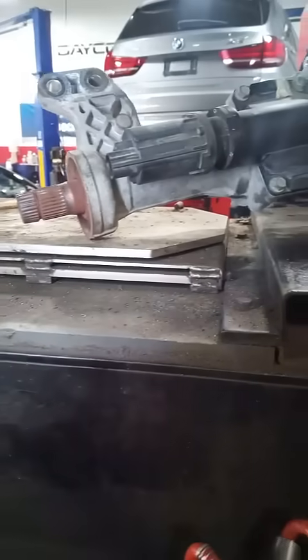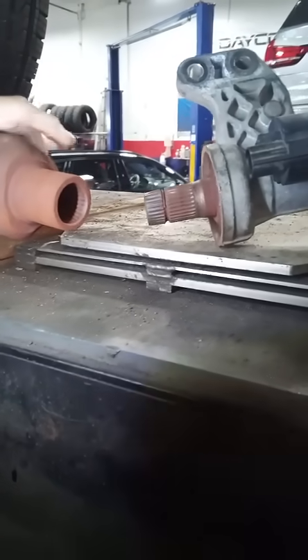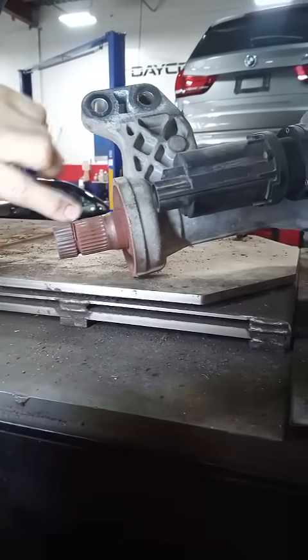Customer came in just for a regular inspection, no questions or concerns, but part of our inspection showed what we've got over here — out of this guy's front differential — this axle shaft was nearly coming right off. The only thing basically holding it on was the force of the axle here. You can see the splines on this shaft are fully worn down.